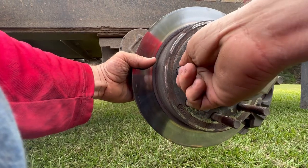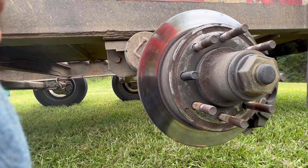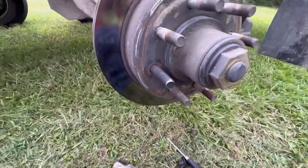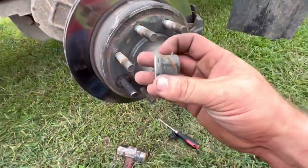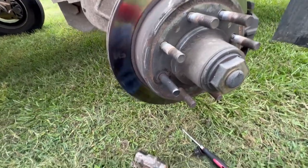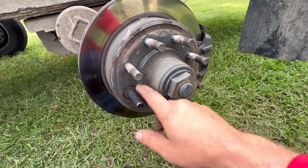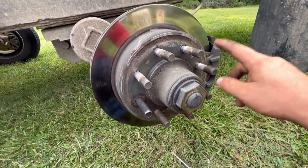You guys ain't paying attention. So I'm going to come behind it with the screwdriver — I'm going to put the phone down again. I'm going to try to tap this thing on just a little bit, but then I'll put my tire on there and pull it on tight. There you have it — it's in there. I couldn't quite tap it in, so what I did is I took this lug nut and put it on and just tightened it down until it pulled it on out. There are several ways you can do this — this is how I do it. Maybe there are easier ways, but that's how I change out the stud on the trailer when a tire shop doesn't tighten my lug nuts down all the way.